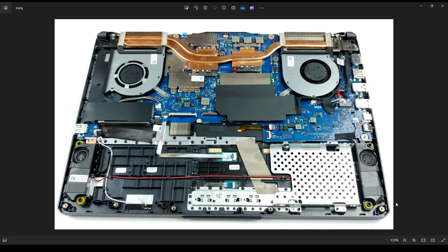Now that the battery has been safely removed or unplugged, we're safe to proceed deeper into the computer. On the left side of your screen on the bottom, you'll see this speaker here. On the right side, you'll see this speaker here. This speaker on the left is not plugged directly into the motherboard — its wires go across here and plug into the speaker on the right-hand side, and that one plugs into the motherboard right here.